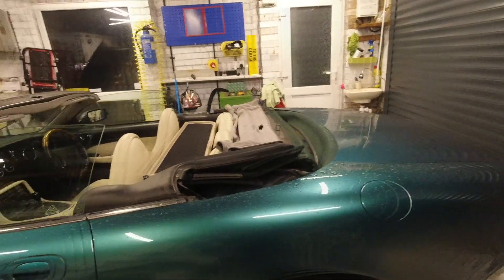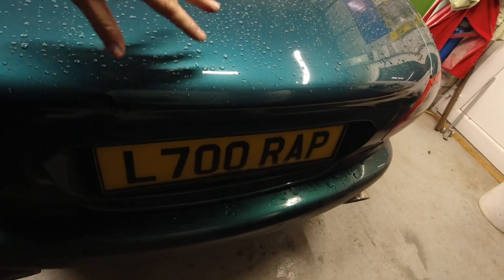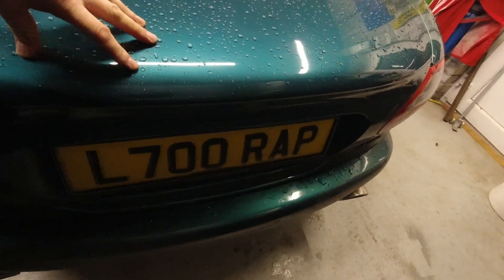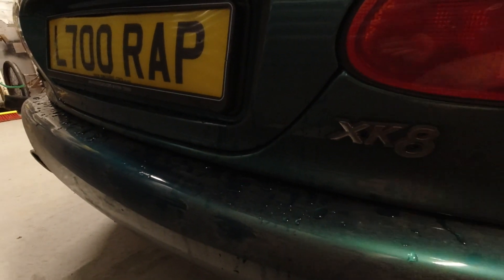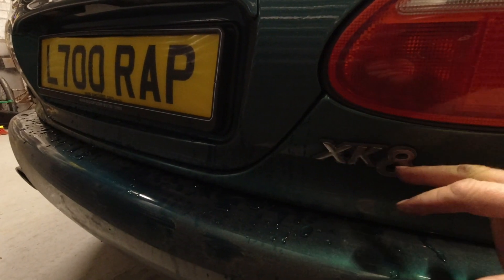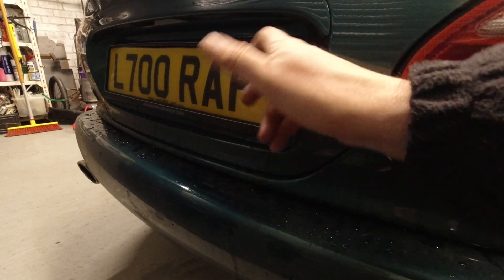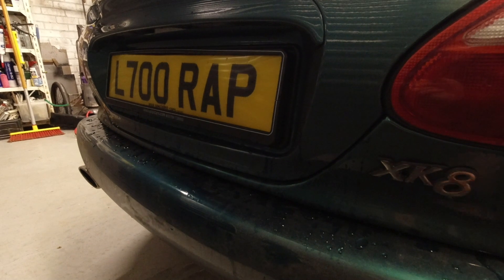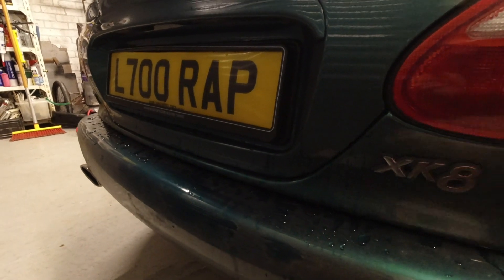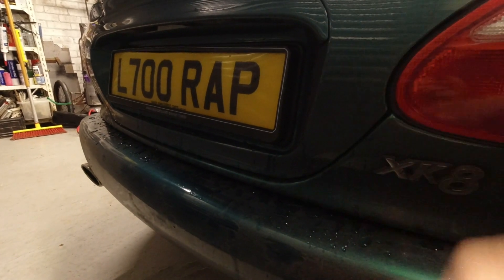Our channel is not very much about the X150 - the aluminium car that came after ours - but there are the odd secrets I share. There's the equivalent of this security workaround, but it's not hidden in the badge. You unscrew your number plate or tear it off if it's been stuck on; behind the number plate is a keyhole - that is your emergency keyhole. Unfortunately you can't test it very easily, but it does mean it tends to stay a lot cleaner.